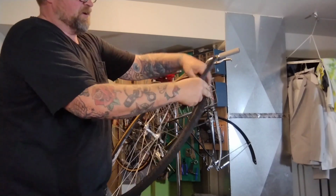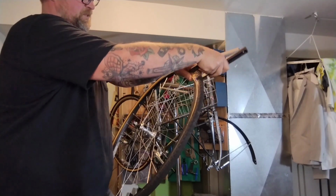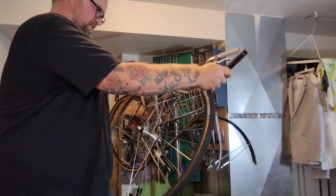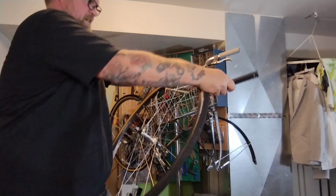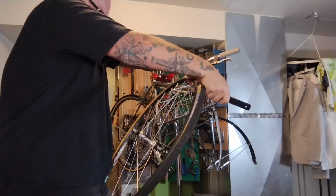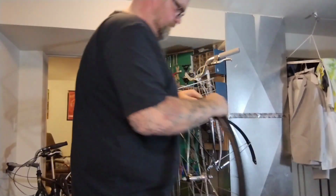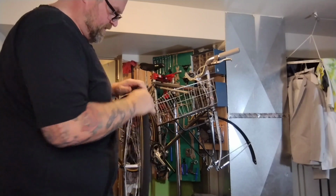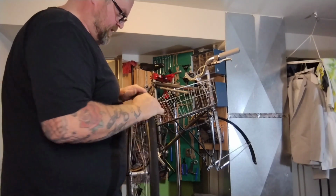Of course, I'm doing it by the valve where there's less room. It's really stupid. I usually do the other side of the tire. But here is where we find ourselves. Use my thumb to help a little too. Get in. Use my palm. Double check in, looking every time, to make sure the tube's not poking in between the rim tape and the rim and the tire.